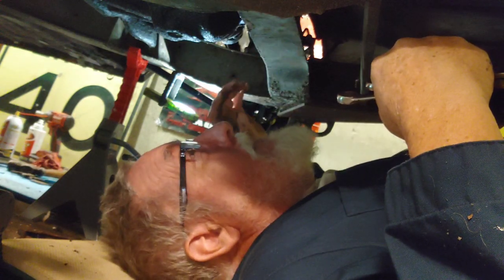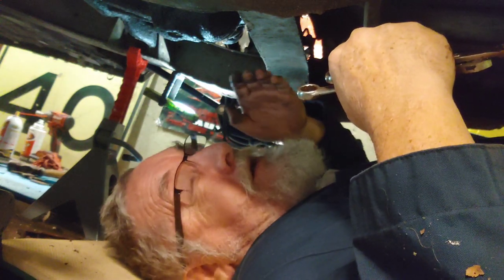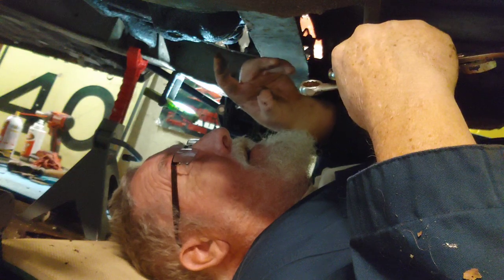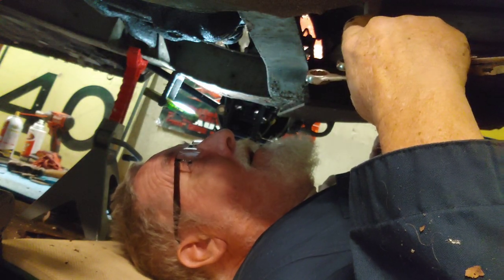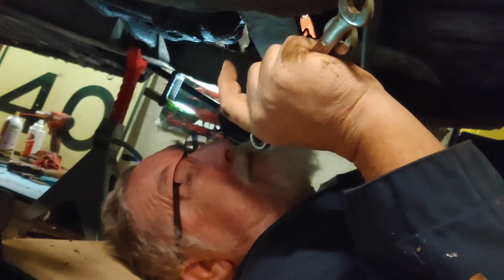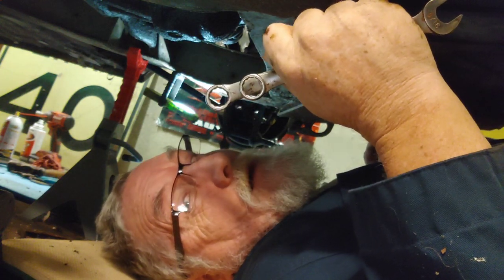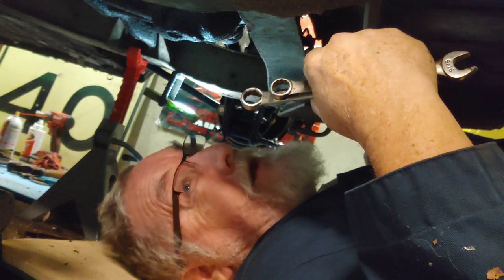So you got to slip them over, all of them, reach up top and move them in, and then rotate, tighten, rotate, tighten, because the pitch of the U-joint coming out of the diff is at an angle, and it gets in the way to where you can't get the box end. You got to use an open end on the bolt head side, and on the nut you got to use box end, and the U-joint's in the way. So you got a certain little sweet spot to where you can get it on and off. And a ratchet, these are 9/16ths, by the way, and a ratchet 9/16ths head is too thick. It won't get in between the U-joint knuckles. So, yeah. We'll keep at it and get her done.